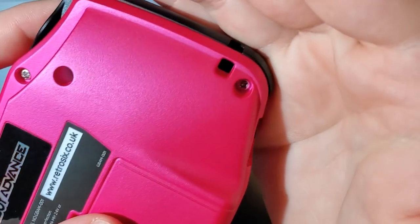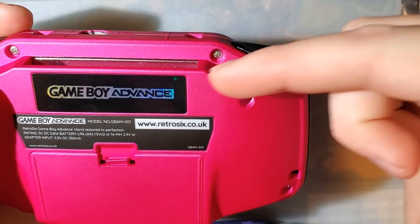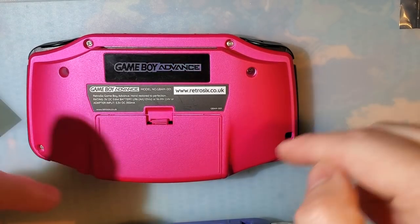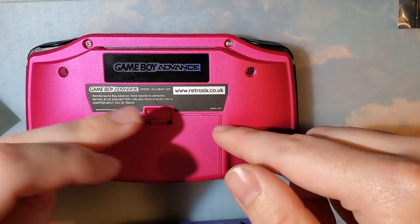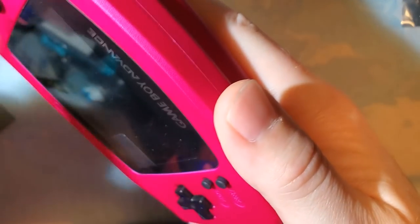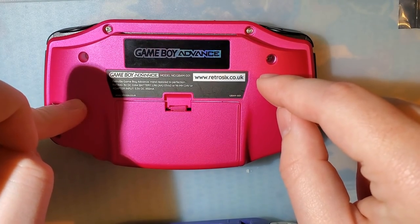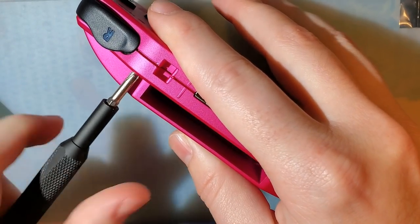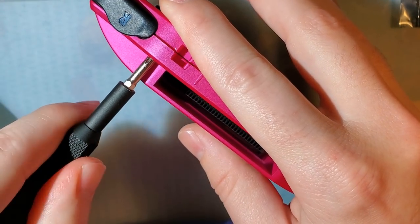On the flip side, the Retro 6 shell also comes with different screws — but they're all cross-head Phillips screws, inside and out, and they went in much easier. They feel so much more solid. Retro 6 took a one-screw-fits-all approach: in the bag you get ten total screws, three for the motherboard and seven for the shell, all the same size. You don't have to sort them or worry about putting the wrong screw in the wrong hole. They have a real aggressive thread pitch instead of machine screws, designed for cutting into plastic, and they're perfectly fine — zero issues.